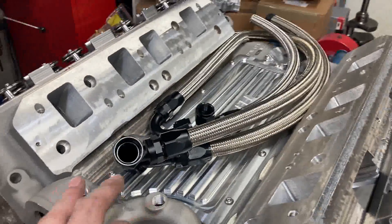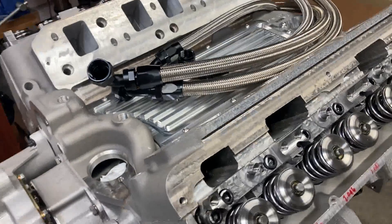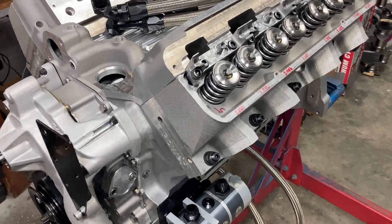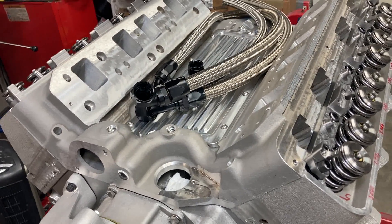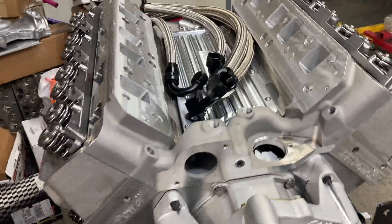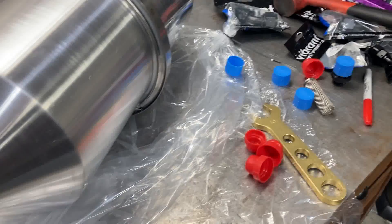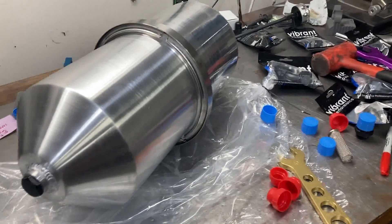Both dash-12 lines are also made up for the tank — one for the pressure side, one for the scavenge side. But I forgot to order straight dash-12 hose ends too, so I'm batting 0-for-2. Once I get those four fittings in I'll be able to finish this up. We're also waiting on a few things from Jay and need to order push rods. So we're going to call it a day. Thanks for watching — I've got a mess to clean up but I appreciate you watching, all your comments and participation. Hope you guys are having a good week and I'll talk to you soon.